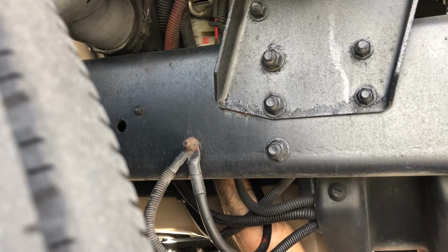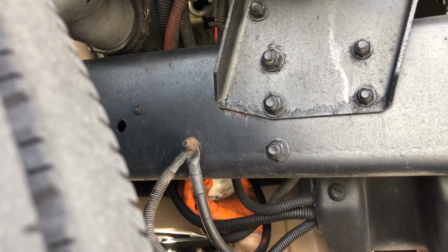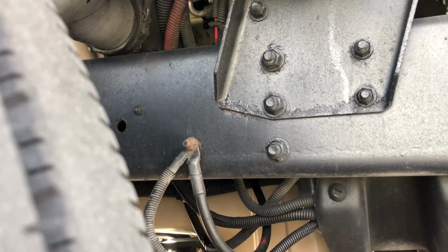Messy job, but it needs to be done. Now I will tell you, I put those on hand tight, but some people might not be able to put them on tight enough. So once you get them up to the gasket touching, try to go half to three-quarter turn past the gasket touching. I recommend three-quarters turn, but you do what you feel comfortable.